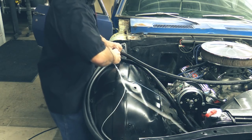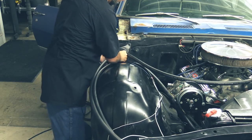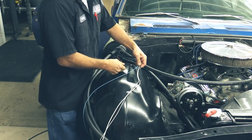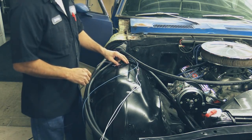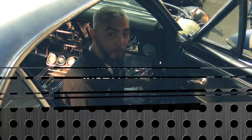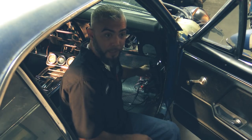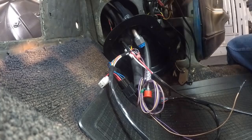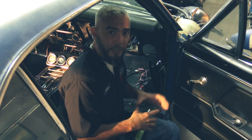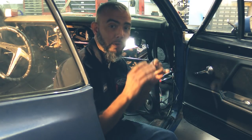Go ahead and bring your wires out and make sure all your wires are out. We'll go back inside now. Next we're going to install our grommet back into where the number 10 line goes. Our next step will be applying a bead of silicone around the opening of your kick panel cover — this makes sure we don't get any air gaps or leaks in your vehicle.